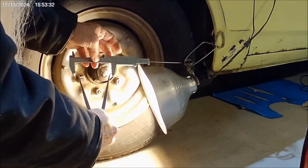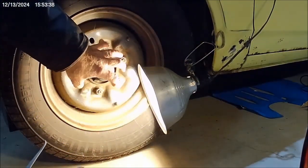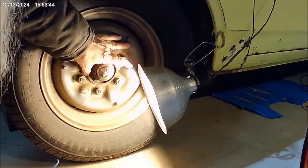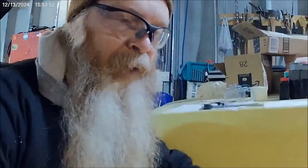So now I go to Amazon and I have to find the right cone that was small enough to go onto that, but large enough where it doesn't fall through the hole. And I've already done it. I'm going to order one — they're like $20 for the large size and it goes up to 4.4 inches in diameter. So it'll fit the shaft on the tire changer — 4.4 inches is 113 millimeters — and so it won't fall through the hole.